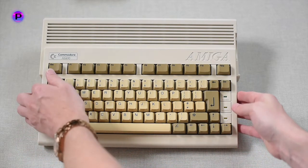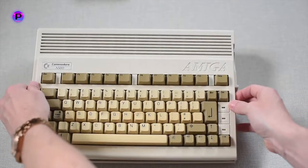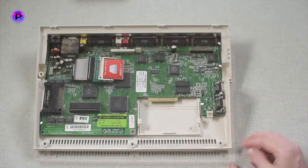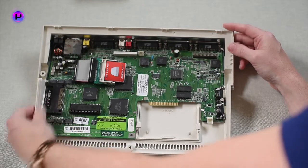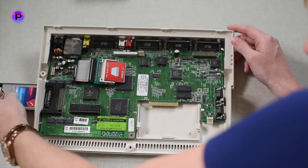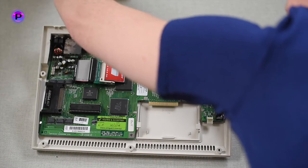Putting the motherboard back in the case is very simple. Just unscrew all the screws from the bottom of the case if they're there, and take the top cover off. Just be careful of those little plastic clips again that I warned about in part 1 of this video. The motherboard may take a little bit of wriggling to get in, but once you've got it there, it's nice and simple. Just make sure that you're careful that the joystick and mouse ports actually do line up. Here I'm testing just whether the PCMCIA cards slot in through the little gap on the bottom half of the case freely.